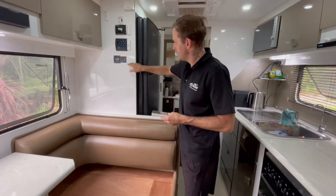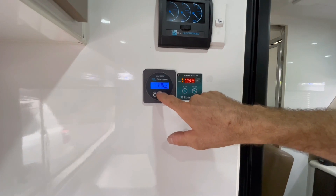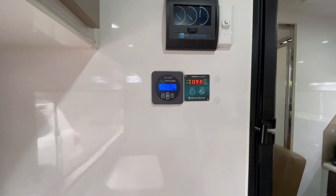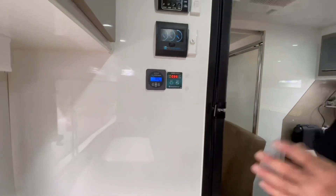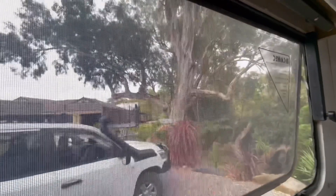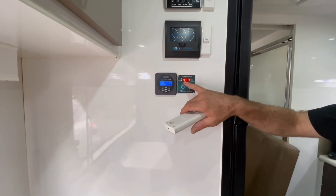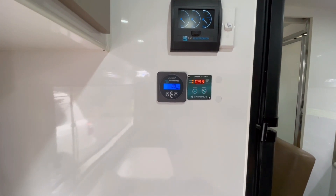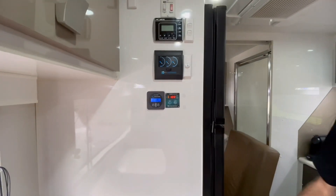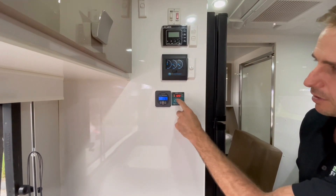Now we're going to try and get the air conditioner to kick in. We've got the IBIS-3 running — finally decided to kick in — and you can see what it's pulling: just on about 1,000 watts, and that'll ramp up. From the battery: 80 amps, and it's going to rise as this thing starts to ramp up. Fans on 3 and we're on 16 degrees. We're getting a little bit of sun — completely overcast and under a giant gum tree — so we're close to peak draw. She'll jump up well into the 90s. This is going to calculate time remaining. Now that'll go down to about 2.2 hours — we had it steady. This air conditioner will run at the current rate for about 2 hours and a bit before it needs a recharge. I've set this for a 20% discharge floor so they're able to see what's going on.